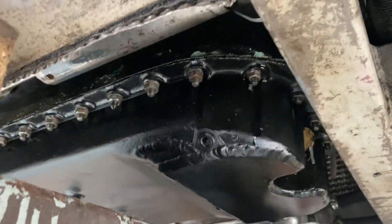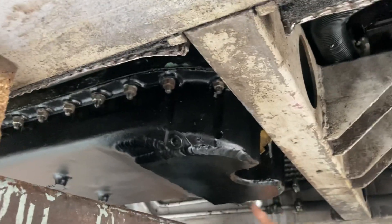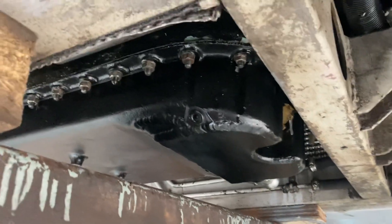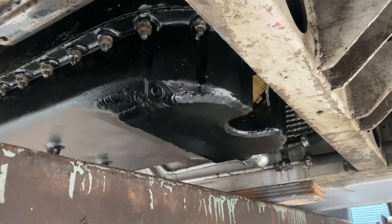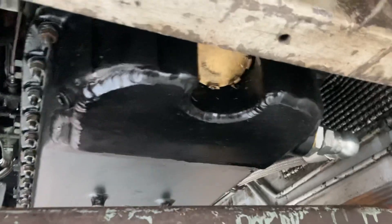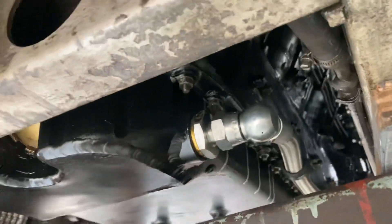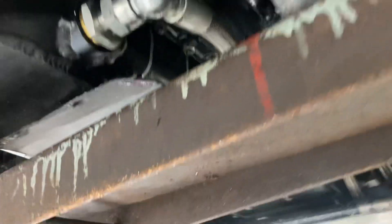That's where we cut a bit off the sump because it had a little pan on there, so I changed the pickup and put it in the side — otherwise you'd lose ground clearance. I ran it with the stock sump and it would catch on the road a couple of times and grind a bit off, and I thought it's going to be through that one day. We're always wiping these odd spots of oil off because you chase the oil leaks until you get them all fixed.